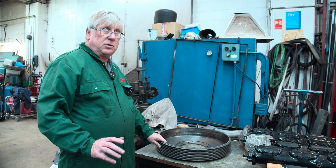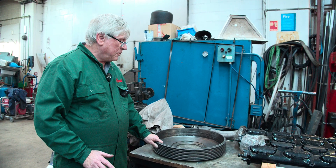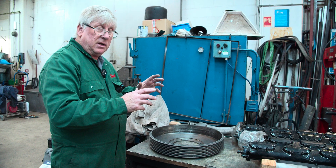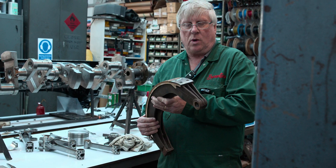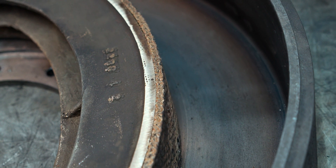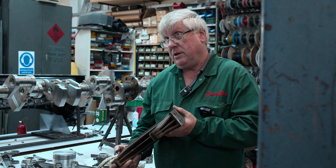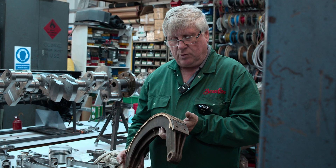The actual brake shoes distorted through the heat that was produced. They were aluminium brake shoes, and we've seen pictures of the lining material moving with the distortion of the brake shoe as it got so hot. This is one of the brake shoes which we've just had relined. The original lining had been contaminated with oil and grease over the years, and it was pretty well full of asbestos, so we thought we'd better do the right thing and remove the asbestos and reline them, which has now been done.